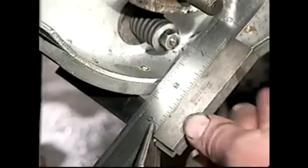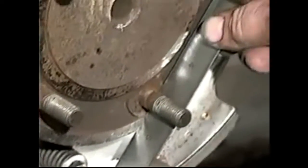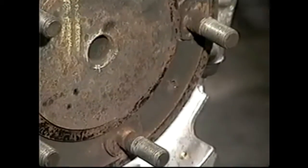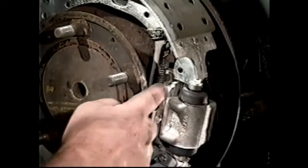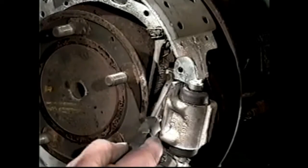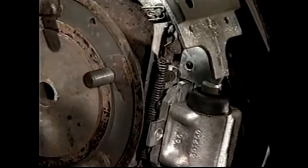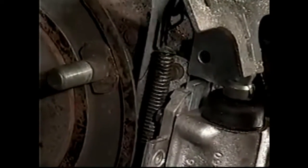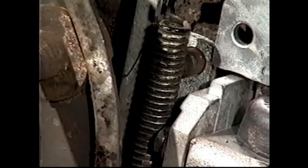These are in good shape. I'll just go around so that I pick up both of these lugs there. I'll check under there, and those shoes are both square. We now need to adjust the compensator. I'm just going to demonstrate to you how this compensator works. What I've done is I've got the square driver on the back, and you can see how that bottom shoe comes in and out towards the drum. And what we'll do is we'll put the drum on, and then I'll set that up, and you'll be able to see the difference it makes.